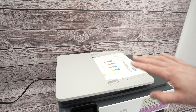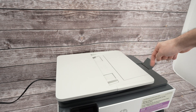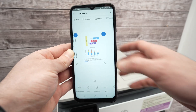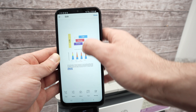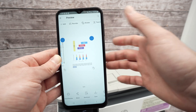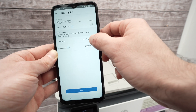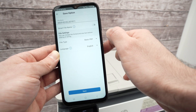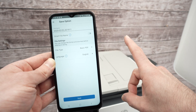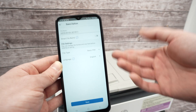You don't have to touch anything while it scans. Important: remove any staples from your paper beforehand or it will jam. You'll get all the pages listed — scroll through them. When saving, select Basic PDF so it combines all your pages into one single PDF file. That's the only key difference.